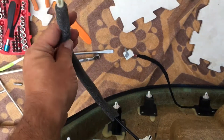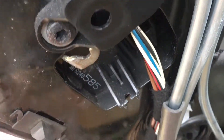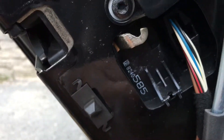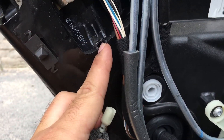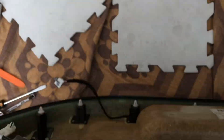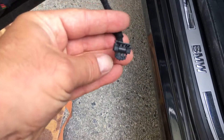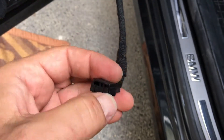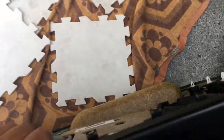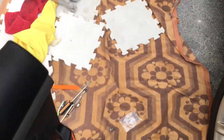This little piece goes here — don't forget to clip it here. You also disconnect the airbag connector. This is the airbag — you unclip it from this side and from this side. And this is the door panel removed.